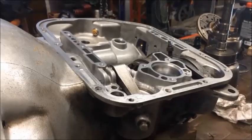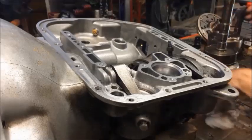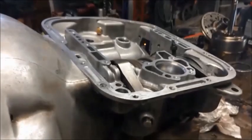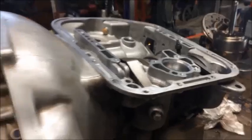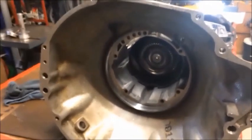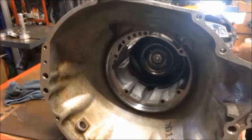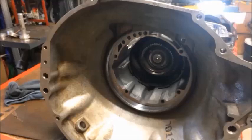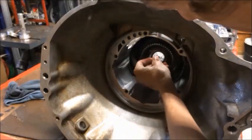Well, that did not work out. So I'm just going to go back to reassembling this transmission the way I've done it in the past, which is to take all of the planetary sun gear and annulus gear and push them all the way back into place in the case. Then we are going to get the rest of our parts — the thrust washer. Take our thrust washer and put some petroleum jelly on it, specifically on the back but on both sides really, and we are going to stick it in there.